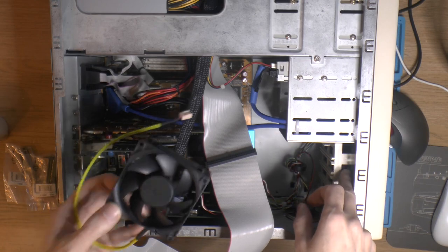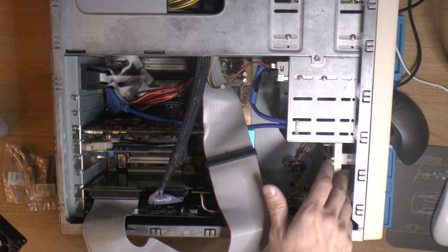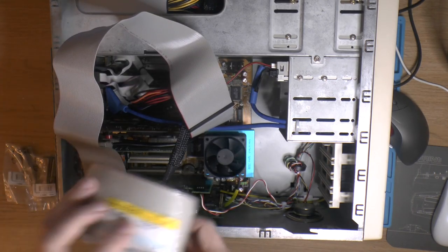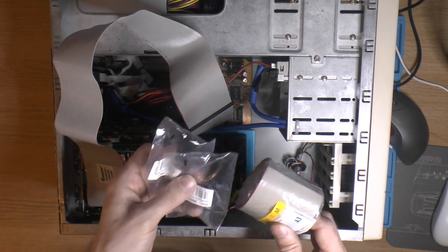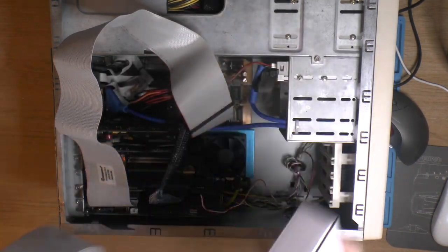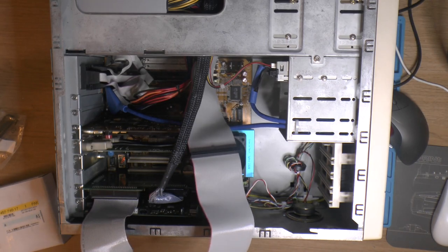I had to swap the Sunon sleeved fan for a slightly lower RPM Sunon Maglev — it's all Maglev now — because the first one was drawing a little bit too much power and triggered some overcurrent protection on the fan header. But this slightly lower RPM one is working fine. I really hate this stock SCSI cable, so I bought some 50-wire flat cable and a few connectors, plus the wire sleeving, to make a sleeved cable that can go up to the optical unit a little bit nicer.